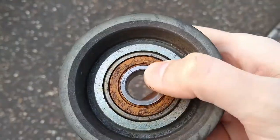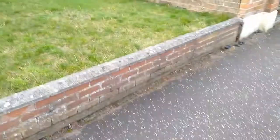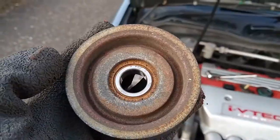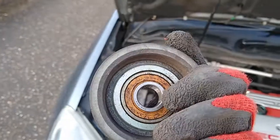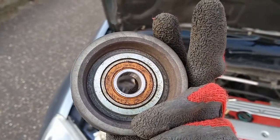I can feel it's notchy. And if I spin it near the microphone, you can hear it rattling. Plus it's quite warm. What we'll do is take this and push the bearing out from that side — hopefully it will come. Really you want to push on the outer race, not on the inner race, but we'll struggle to do that here.